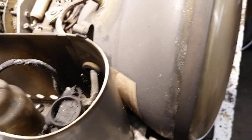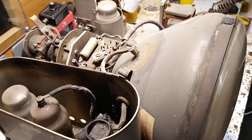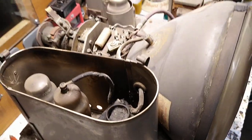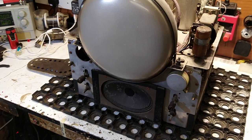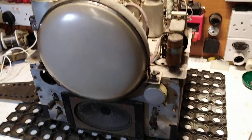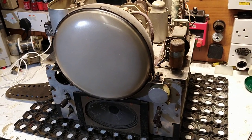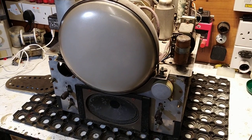The first job I'm going to do now is turn the set on its side, give it a bit of a vacuum, and then we'll take the small receiver part of the deck out — which is the bottom chassis — and have a look at that. Once we've got that out, we can start replacing capacitors. We've done so many of these sets that we know all of the capacitors will need replacing to make it stable and the telly worthwhile to use.